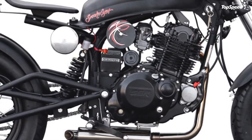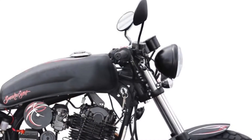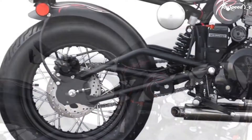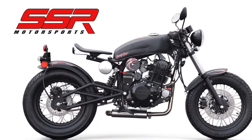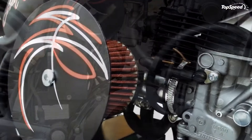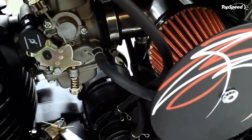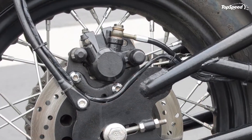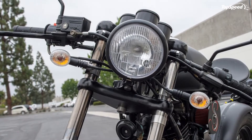Chassis. This is a basic, honest bike with a homemade look and no frills. The frame uses a single down tube, stressed-engine layout to keep weight and bulk to a minimum, with tubular steel members making up what little skeletal structure there is. That same material forms the truss-like swingarm for a simple, homemade look that fits well with the rest of the bike. Right-way-up forks support the front end, with a coil-over monoshock managing the motion at the rear.